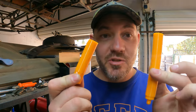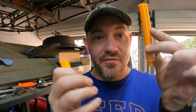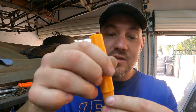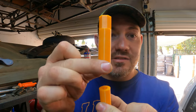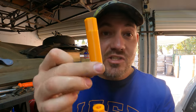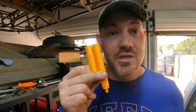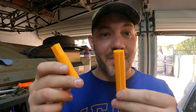I came up with this solution. I quickly modeled this in SolidWorks and printed it. My idea was to have this go into the cylinder head, bolt on, and then I can unscrew it until I can determine the height of each injector. This takes five hours to print. Then I realized the flaw — this part might turn as I'm trying to unscrew it and I can't grab it. So useless.